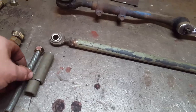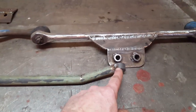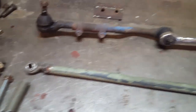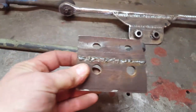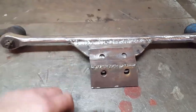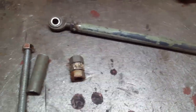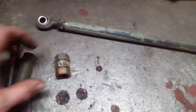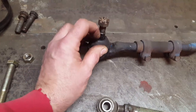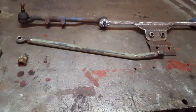I ended up with quite a large spacer on the outside to get it where it was good - better than good actually. But I can't see having that spacer that long because you're going to have a lot of strain on it. I wanted to get it shorter, so I figured if I moved this inner location up an inch or so, that would change the geometry and everything would move up. I made this little plate up, mocked it all up, that would bolt down to the car as my new shock mounting location. I ended up with an inch and five-eighths of a spacer - I'm happy with that.